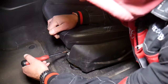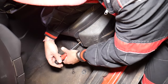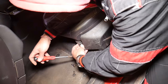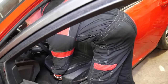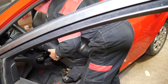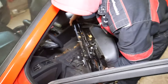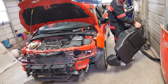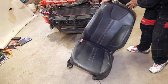Most of the time you need to tilt the seat towards the back. The wiring harness may be attached to the seat or located under the seat or on the floor. On Chevys, for instance, connectors are often under the carpet and you have to lift the seat front to access them. On Ford vehicles it's usually pretty simple. Once disconnected, carefully grab the seat and pull it out, being careful not to scratch things. Power seats are usually much heavier than regular seats.